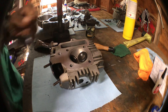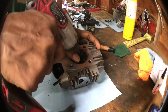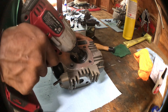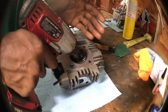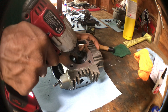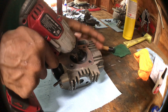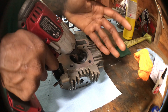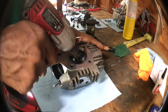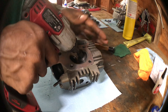Make sure your hands are clean — you don't want this stuff getting into your actual valve seal. Slide the valve into your head, then use your tool or your hand and spin and grind. You'll hear the difference in sound — right now it's very raspy sounding because it's cutting the new seat. Then see how it gets quiet — that's the compound doing its job, breaking down into a smaller grit to smooth out all the imperfections. Keep lifting the valve after you turn a little so it gets all the grinding compound distributed.